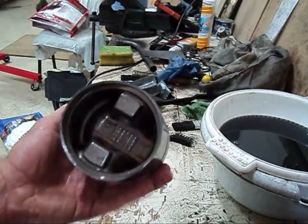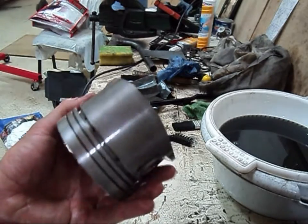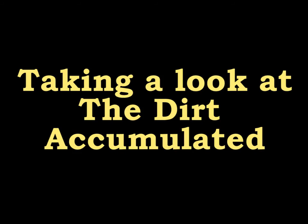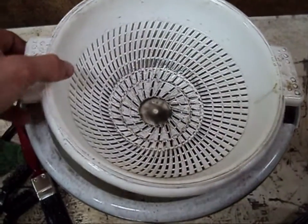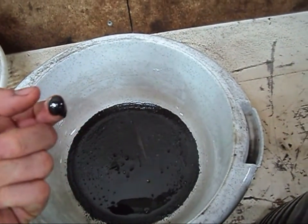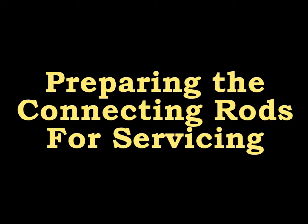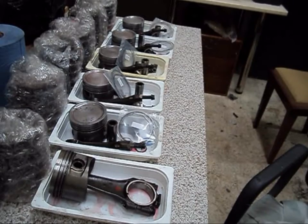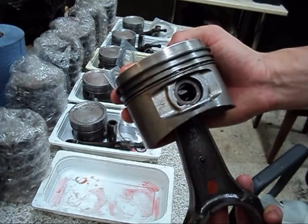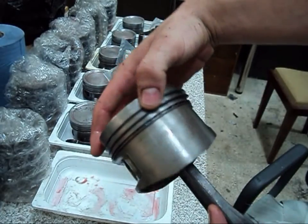Here's the end result after a considerable amount of polishing, where the aim was to have the engine components as clean as possible. This is what remains after cleaning the internal components of the engine — all this gunk, but at least I'm glad I got rid of it. Now that all these parts have been cleaned, here's an example of how the piston should look when reassembled. All components still need to be cleaned of any diesel residue and smeared with some assembly lube to prevent contamination when stored away.